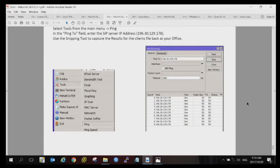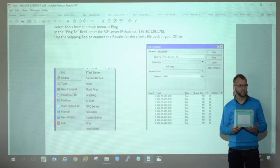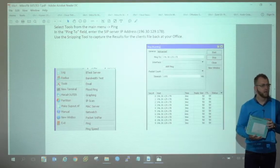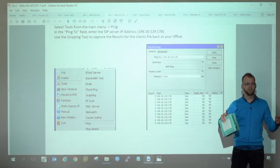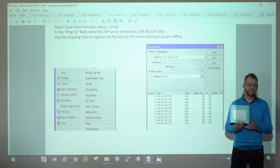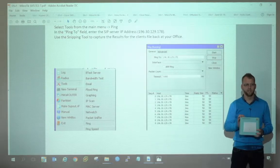Okay. Keep in mind, these LTEs, for example, this one that we have here now is the MikroTik LTE. As I mentioned earlier, if a client requires 3G failover, we have the Huawei LTE, which we are doing currently. The other router that we do is a Billion router. The Billion router is a dual SIM router. So if you have a client that's got Vodacom and Telkom for failover, you'll have two of these routers. One of these routers will, for example, have the outdoor aerials. We don't have them here, but they're big white plastic aerials that will be mounted outside on the pole.